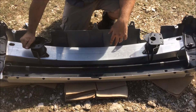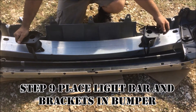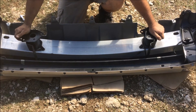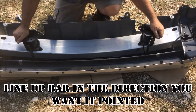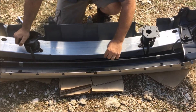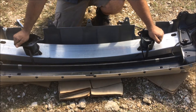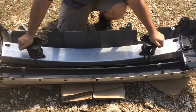With the bumper off, install the bracket on one side and slip it into position, then come from the other side and install the screw. It could be a bit of a challenge if you're not patient. Line up the bar so it is pointing in the desired direction — don't worry about height because these brackets have height adjustment. When tightening the bumper down, push from the bottom on the brackets and get it centered into the slot.